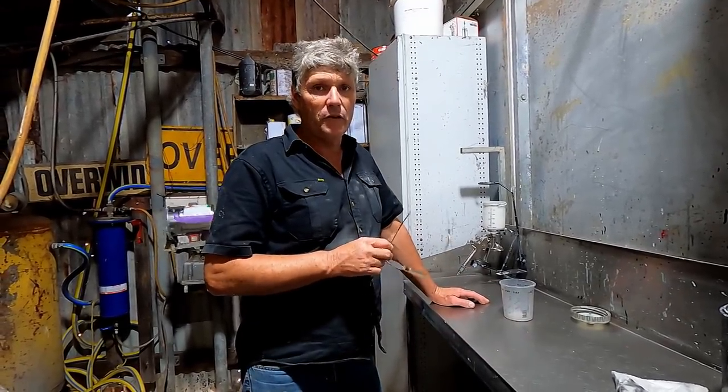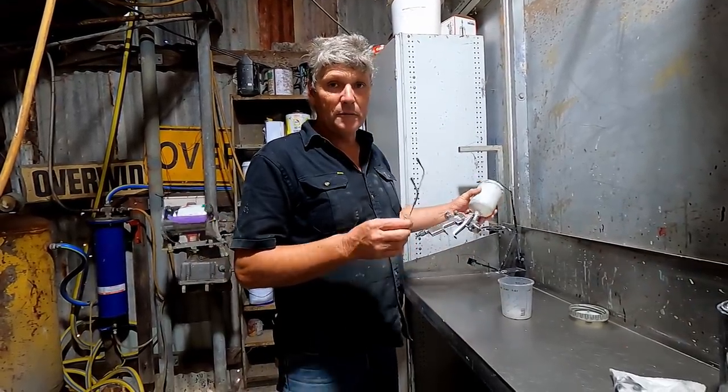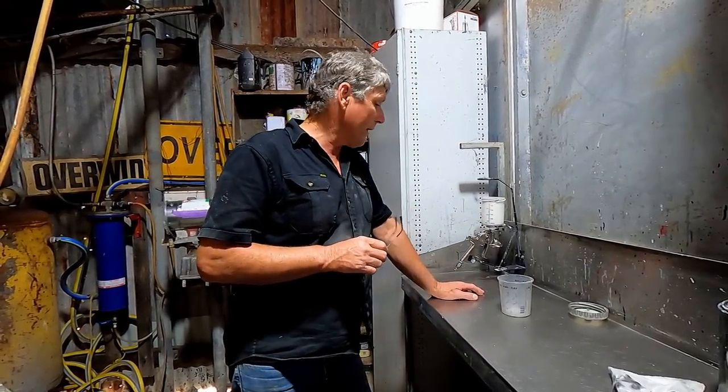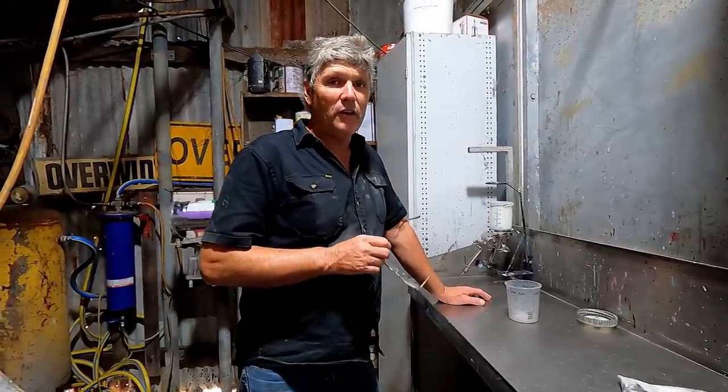I'll give it two coats, and I'm just going to use a normal top coat gun. It's pretty runny stuff. There's no need for a primer gun for epoxies because they're usually very runny. And so that'll seal off our bare metal. It's pretty hot today.